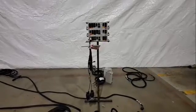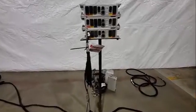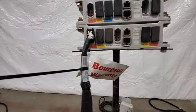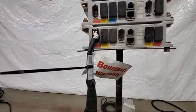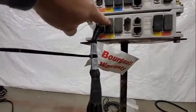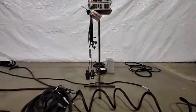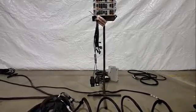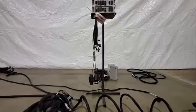If you're running the Topcon single run blockage, one of the EM24s on the drill will be used to control that. At the ECU, looking below, we've got one plug with inputs 1 through 14, which will do 14 blockage sensors. If you have a six-manifold system dual chute, that'll give you enough for one on each tower. If you have an eight or a ten, you're going to need inputs 15 through 28 to accommodate the extra sensors. All the leads are located right on that little sensor harness, and that's where the blockage sensors plug in. Sensors right on that tower won't need extension harnesses, but if you need to go further out, extension harnesses are used.